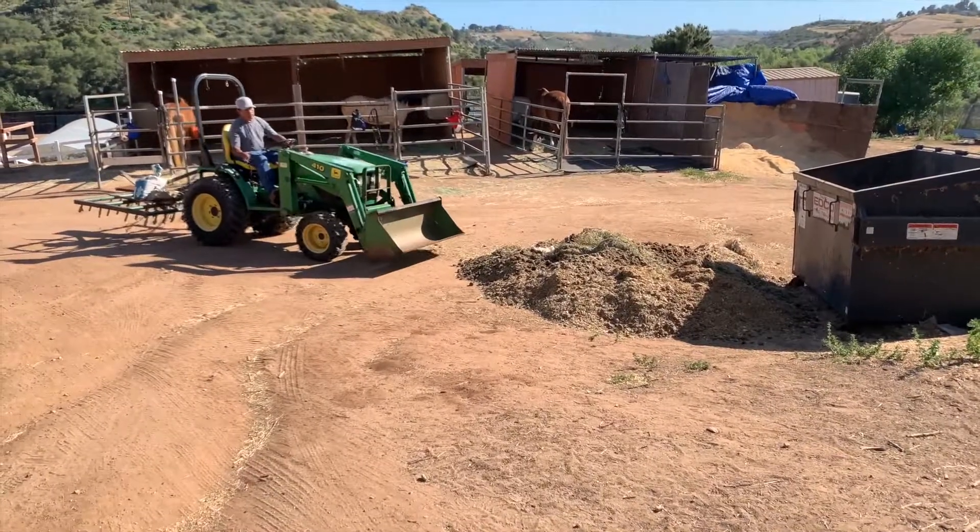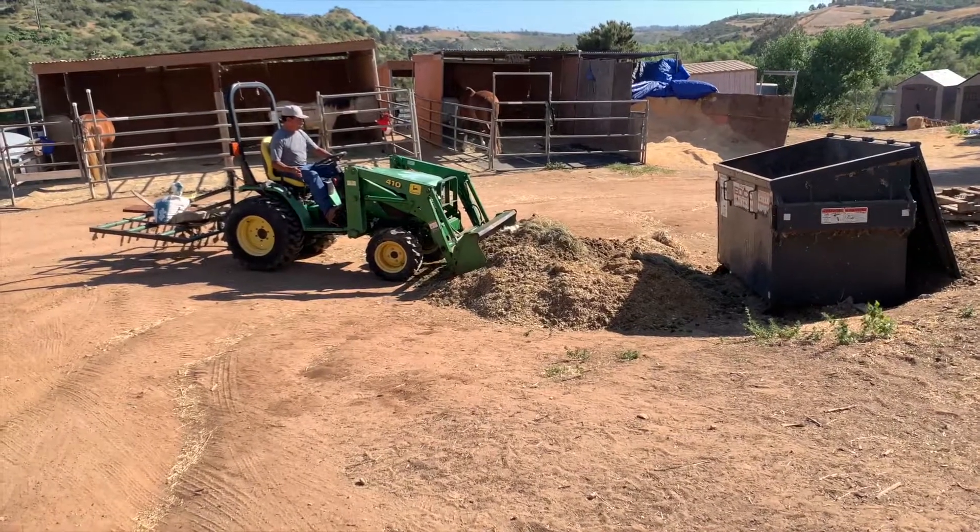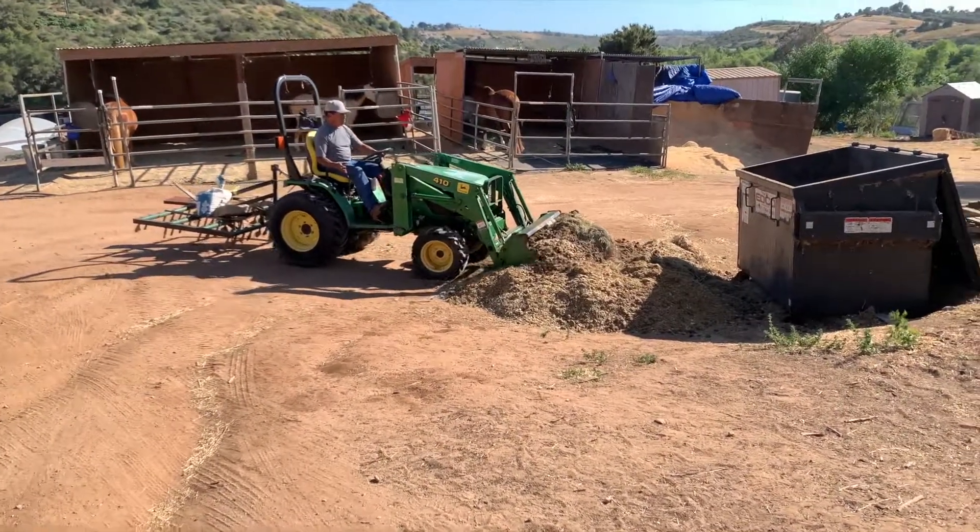Now that we've rebuilt the cylinders, it's time to put it back on. Put the hoses back where they were — this steel line goes back over there. Don't fully tighten them yet, just because you're going to have to bleed them and in order to do that you have to loosen them up. The hydraulic cylinders are rebuilt and the tractor is working good. I hope I was able to help somebody out with this video — I tried to put in as much detail without extending the video too much.